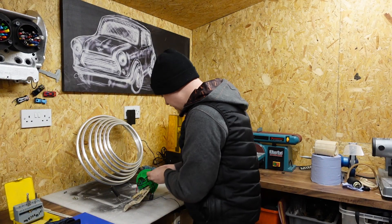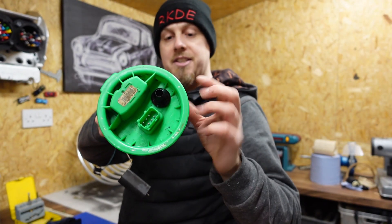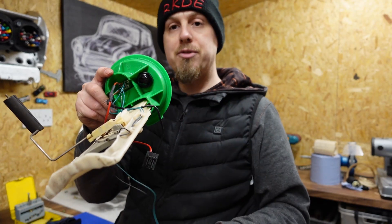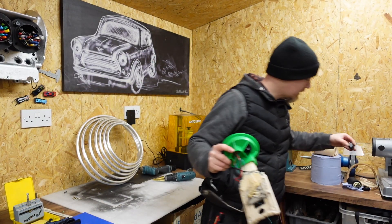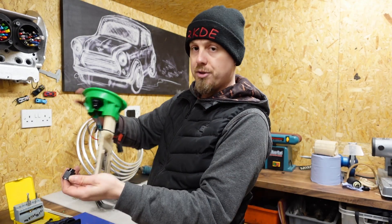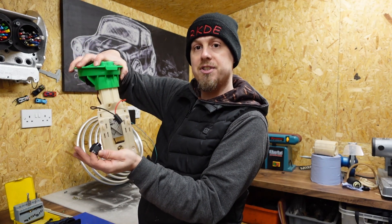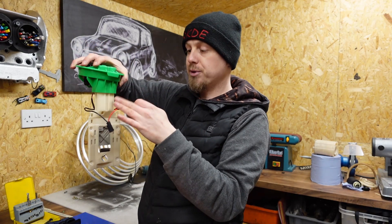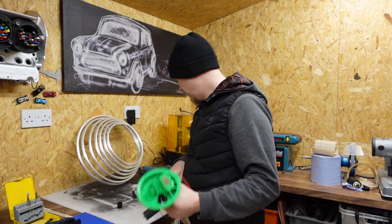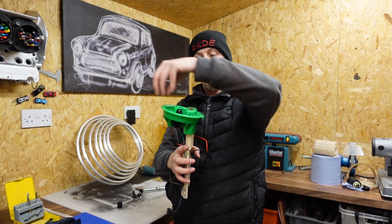Here's the nut - a standard dash 8 nut going on this side. It fits, and we're the right way around. On the inside you can see the return pipe fitting which has a little insert that goes inside the aluminium pipe. Be aware that this isn't necessarily where you expect the bottom of the tank to be - it's adjustable to fit several different tank versions. I need to run back to the tank and take a measurement to see where the bottom actually is. That's gone in really well and my fitting can now go on.